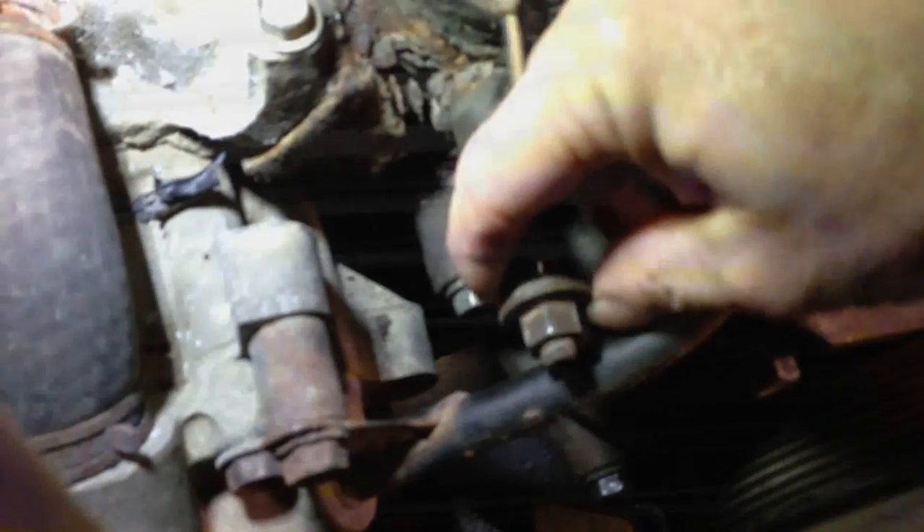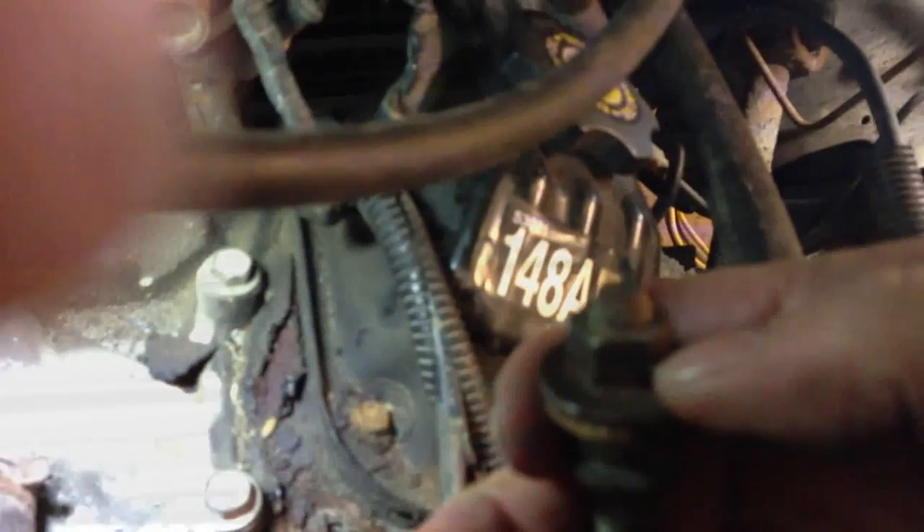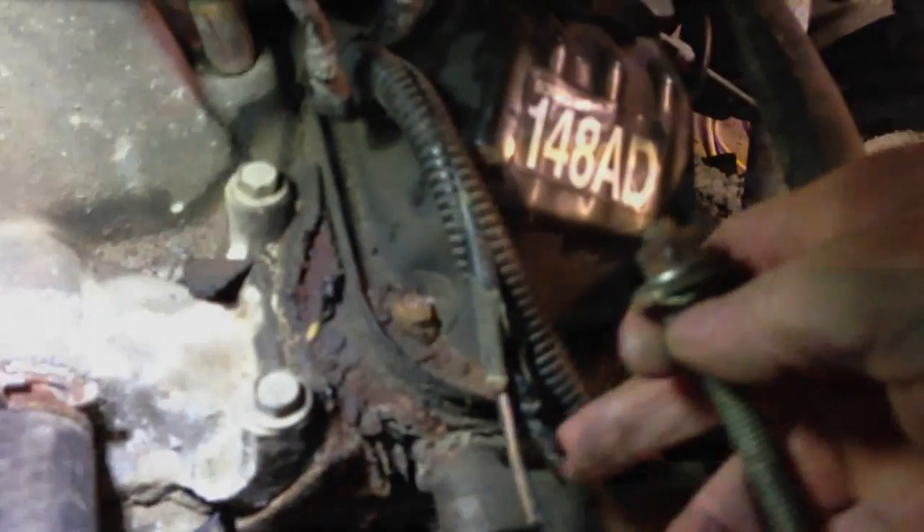So what we're going to have to do — if you look at it closely, you'll see that is not a nut on a stud; it's actually a bolt with a nut there. So what we'll have to do, we'll heat that up in the vise with a torch, take that nut off, crimp on a couple of new terminals right onto the lug, put it back together, put the serpentine belt back on, and we should be ready to roll.